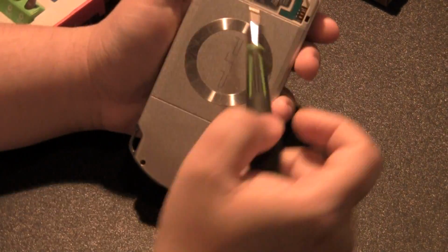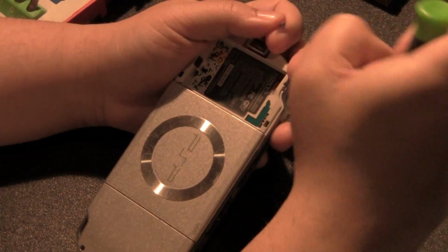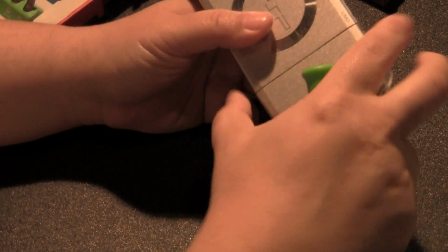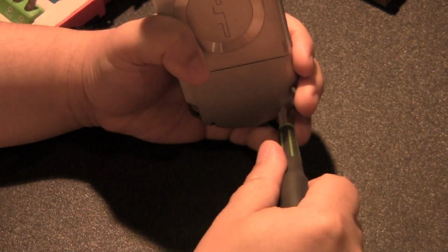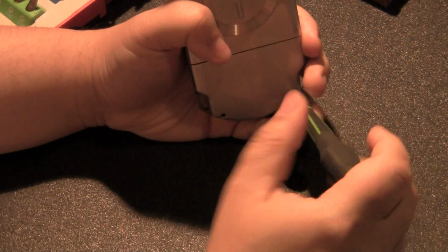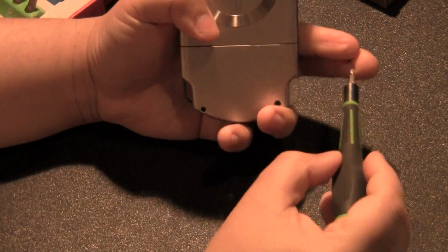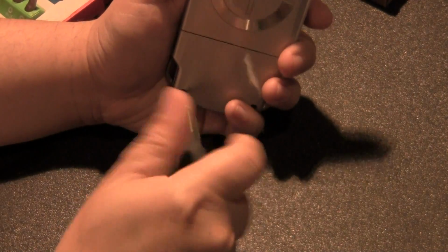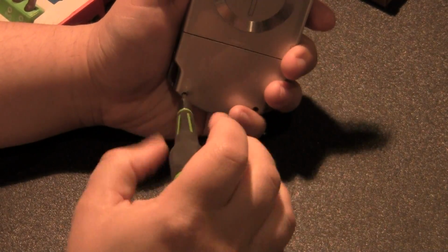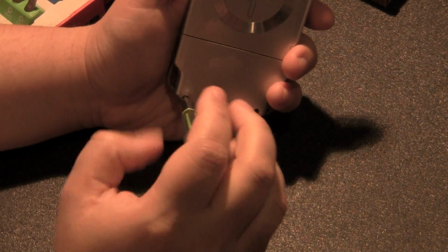Now, those of you guys who are not replacing the screens, once I get inside, I'll show you what I mean about the screen. You just got to be careful when you take this apart. Just because you have all the screws out doesn't mean you relax. You never relax on this kind of build, because the stickers are like paper. Inside here, you're gonna see, wow, what the hell is going on here? They're like paper in here, and if you just pull it out quickly, you'll break the seal. You'll break the sticker, and then you have to wait for new parts. I don't know about you, but waiting for new parts for this thing is a pain in the butt. It took a while to get these parts.